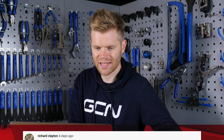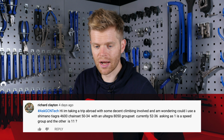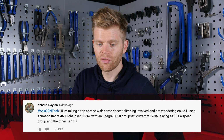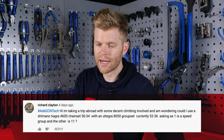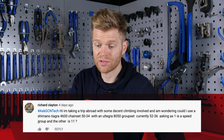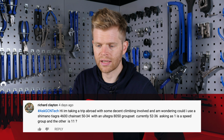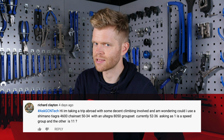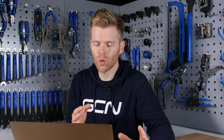Give it a go. Our next question is from Richard Clayton, who says, "Hi, I'm taking a trip abroad with some decent climbing and I'm wondering, could I use a Shimano Tiagra 4600 chainset, compact 50-34, with an Ultegra 8050 groupset, which is 11 speed, which currently has a 52-36 chainset on there." So he wants an easier gear. The problem he's got is that the Shimano Tiagra chainset is 10 speed, Ultegra 8050 is 11 speed. So it may work to some degree, but I wouldn't recommend it.